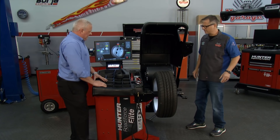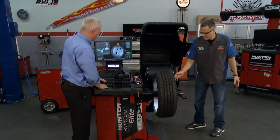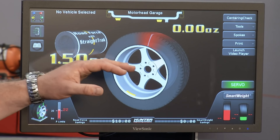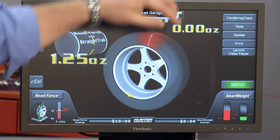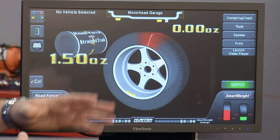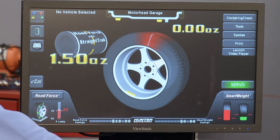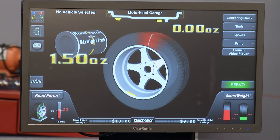Let's walk through some of the options and screens. I know we can't put weights on the outside of some composite or alloy rims. There's static balance, dynamic balance — all kinds of things going on. There are a lot of different arrays for rims and tires. We have a touchscreen where you can change different settings. You can do outside clip weights, inside tape weights, a variety of things. We can actually hide our weights underneath behind the spokes. With the 3D mapping, this is a five-spoke rim, and it actually shows a five-spoke rim on the screen. If we had a six-spoke rim, it would show six spokes — it's that accurate.